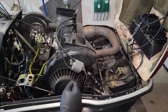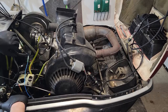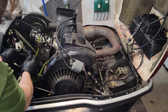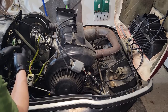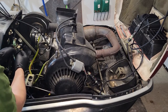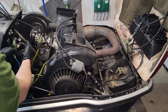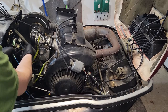Back here on a blue wire there's just a bullet connector. The connections at the CDI are all stock, and the connections at the voltage regulator and electric start are all stock. The differences are at the control side - most of the lighting and switch stuff use the same plugs. The kill switch plug was this old square style and the new one has a Yazaki, with a third wire for what I think is a throttle cutoff. I made a little adapter between the two.